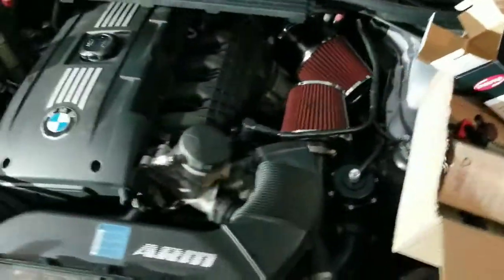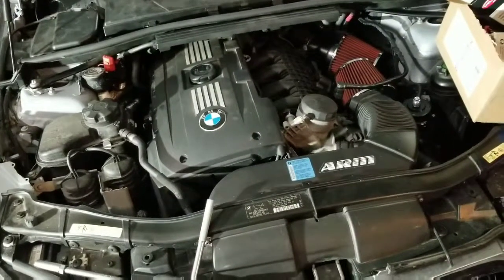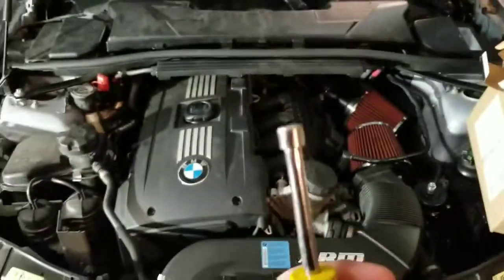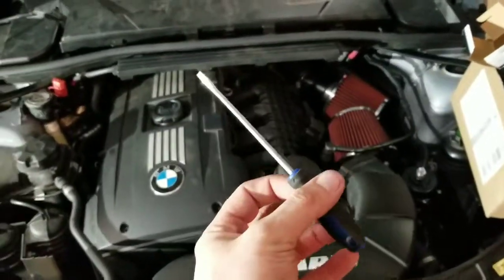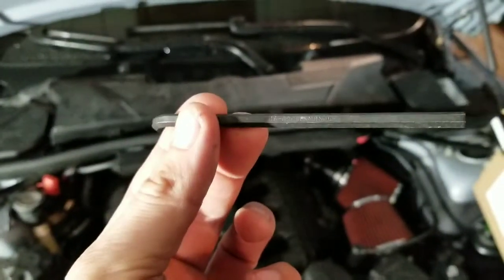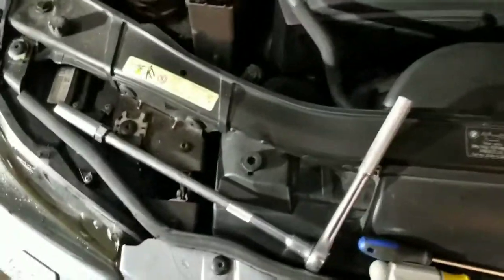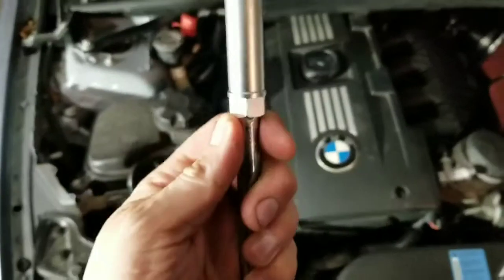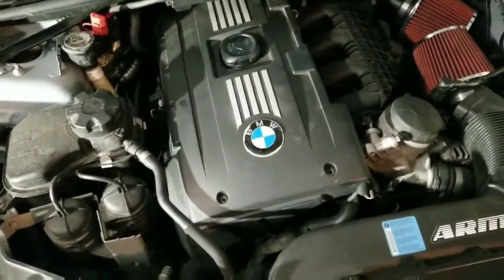I will probably also recheck the gap on the plugs. But basically, it's pretty simple. You just need an 8mm, either a socket or a nut driver, a small flathead screwdriver, a 3/16 Allen, unless you have a bolt-on socket, and then your ratchet with your thin-walled 12-point socket for your plugs. Like I said, I'll put links in the description for those.